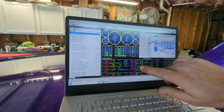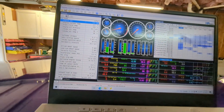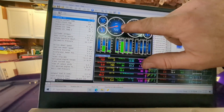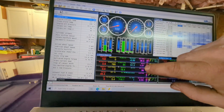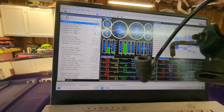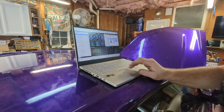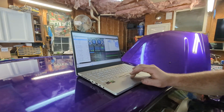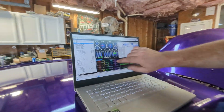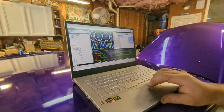Right here we've got the logs from Sharon's car when she broke the driveshaft — so before the new engine. She's making almost 9 pounds of vacuum at idle, 9 pounds of vacuum, AFR/lambda at 1.0 — enough to open this valve up. But if we go to the log after the new engine, you can see she's only making 3 pounds of vacuum at idle.